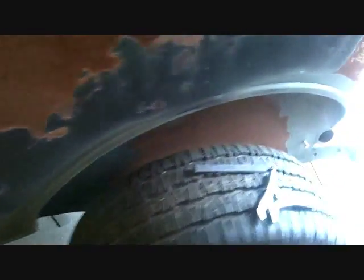When the B-pillar and the A-pillar and the doors line up on both sides, I'd really love to trim out these wheel wells because these were just temporary. You can see the gap here — I'd like to tub it into that point, not ridiculous but up to that point. It's like an inch and a half, so that's probably going to move in when I pull the B-pillars in.